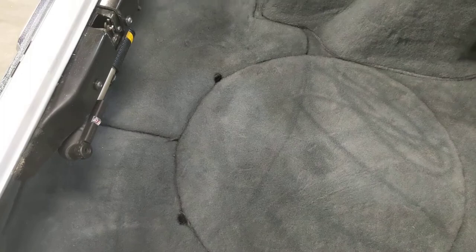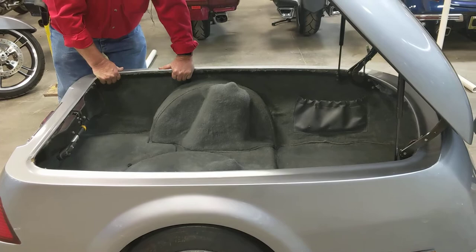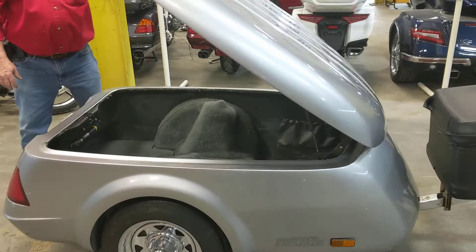It's got air shocks and a little air pump back here with a nozzle. Because I pull trailers like this all the time, what I do is load the thing down and get it where it works right in the shock area — not all the way down or all the way up. They just ride like a dream back here.